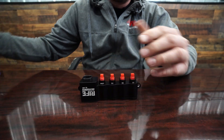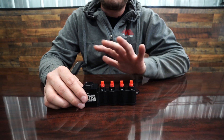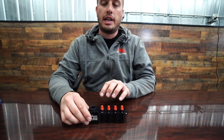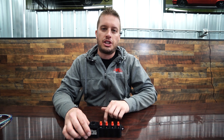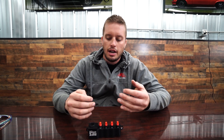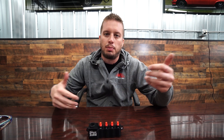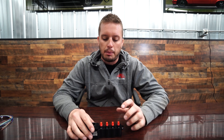It really simplifies all the different wiring bundles. It is a 6-pin connector, so you're going to have your four sensor signals and then a shared ground and a shared 5 volts. So if you're running a Holley system or FuelTech or something where there aren't a bunch of extra 5-volt sensor locations, you can just pull one and go to it — you don't have to keep splitting signals. That can always be kind of a real big pain.